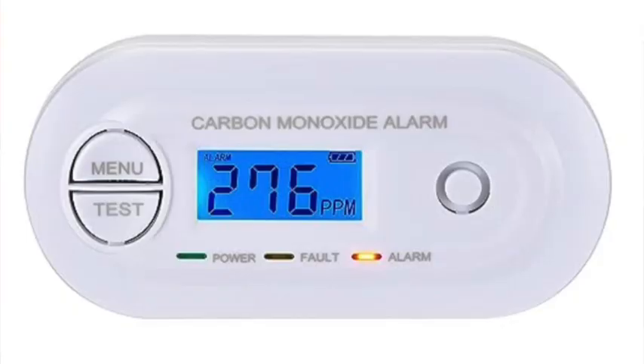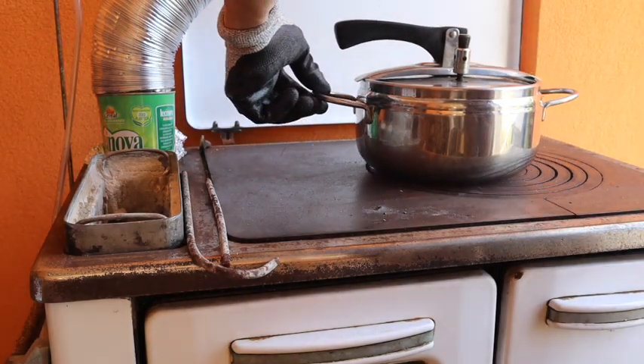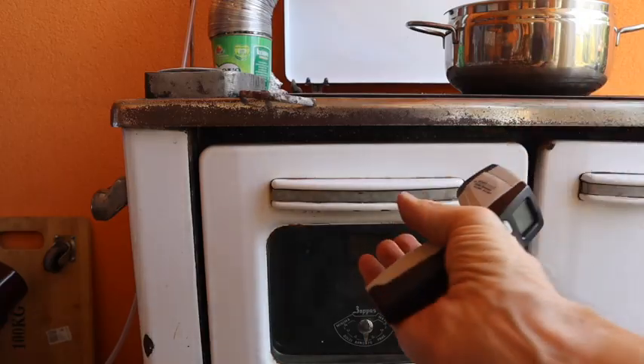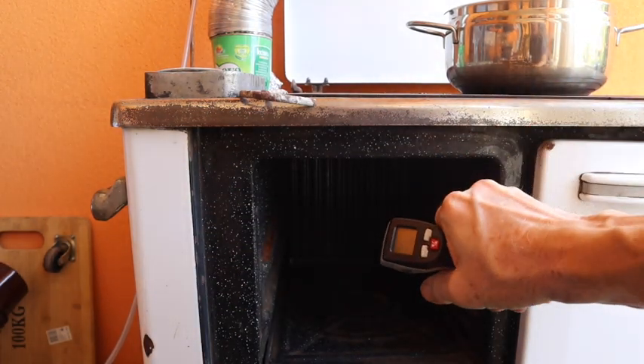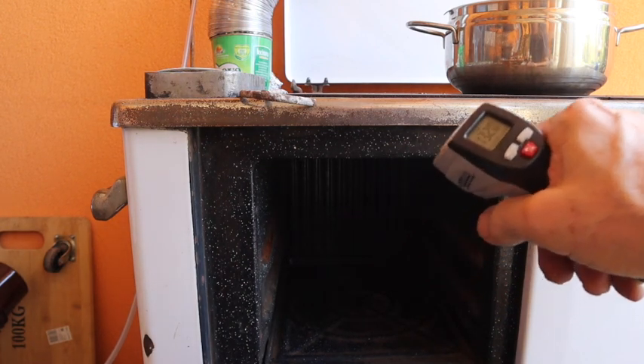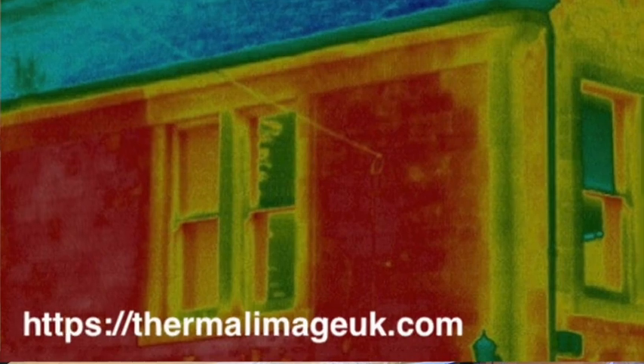There is also the hazard of carbon monoxide, so avoid fume leakage. The description under this video contains an alarm against this dangerous gas. Another problem is that the fumes can be dirty, especially when starting the fire — so use dry wood. The stove can reach temperatures of 300 degrees Celsius and even higher, so avoid burning hazards. Control the heat applied to your food by moving the food around. Consider also using an infrared thermometer, available at a reasonable price in the description. You can measure the temperatures of the stove but also check heat leakages in your house and understand where it needs more insulation.